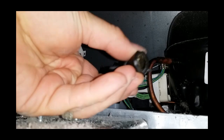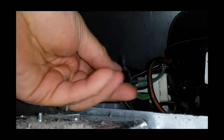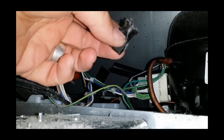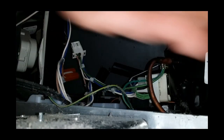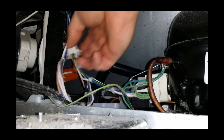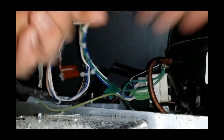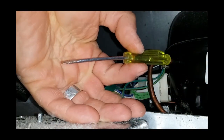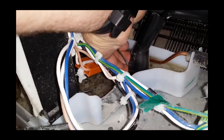So now it's out of the way. There's the problem device — the grommet. This one is really sticky, sticking to my hands, and that is what gets blocked up and what we're going to replace. With the trough gone, I take my screwdriver and get it in behind, because there's a little button that needs to be released from the back side. I'll need both hands for this.